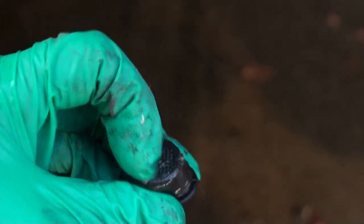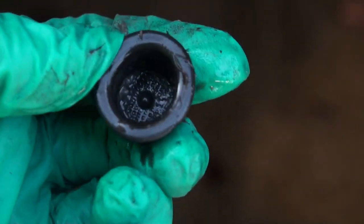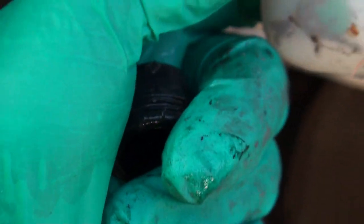There's all this stuff on it. Can you see that? Well, it could just be blocked up, couldn't it? It could be biofilm built up inside this tank. That's the trouble, you know. If you don't use the right washer fluid, if you just put water in the summer and some normal soap, you get bacterial growth. And when the bacteria starts to grow, you've got a problem.